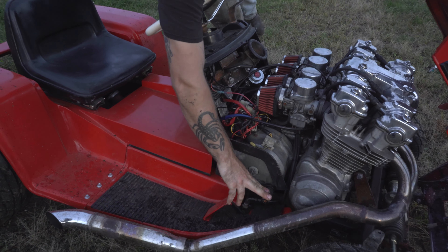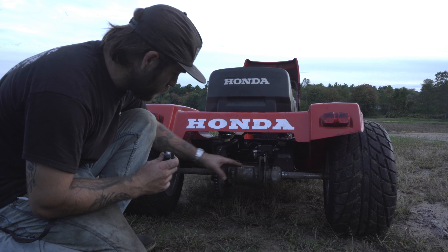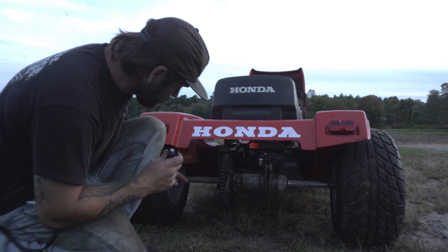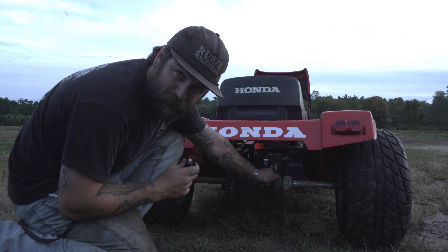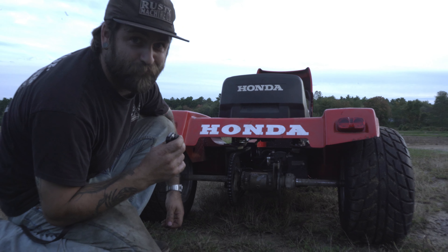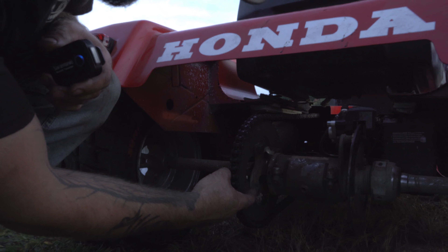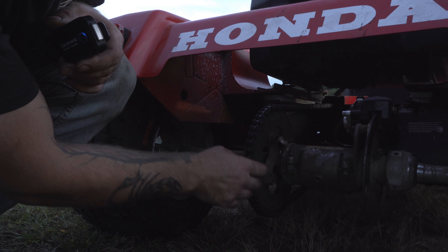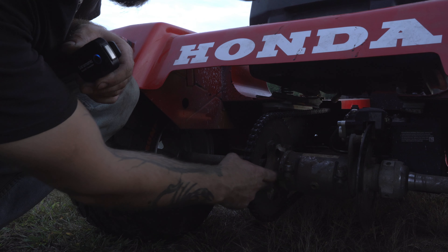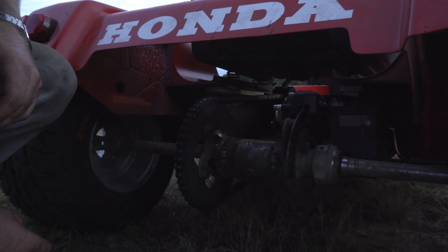That's the brake right here. The rear end in this thing came out of a 300EX, but it's not a factory 300EX hub because those suck — this is an aftermarket hub. We've got an extended axle, factory rear brakes from the 300EX. We do not have front brakes; I don't think I really need them, I've gone plenty fast and been able to stop. This sprocket I actually had to CNC design and cut with my plasma cutter to adapt to the size of the chain on the engine and fit onto the hub. That worked out — I'm curious how long it'll last because it's just regular mild steel, but it's working great so far.